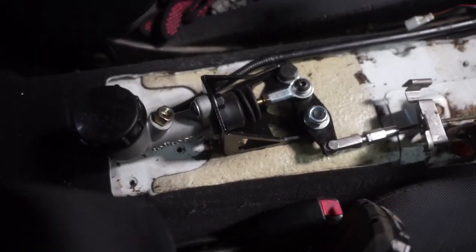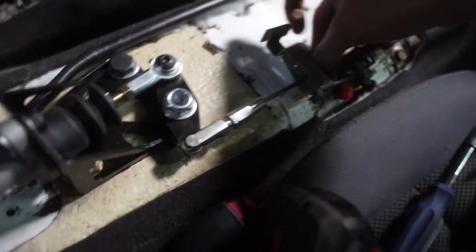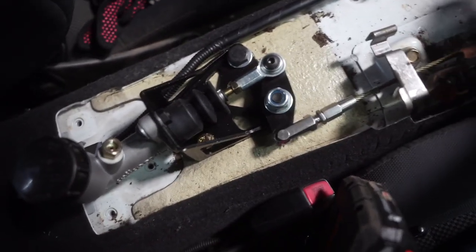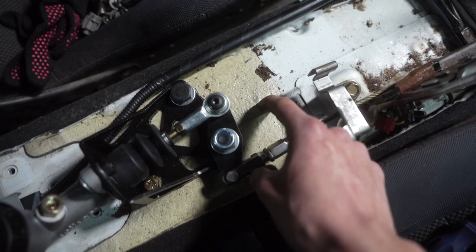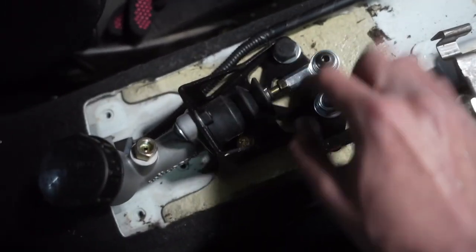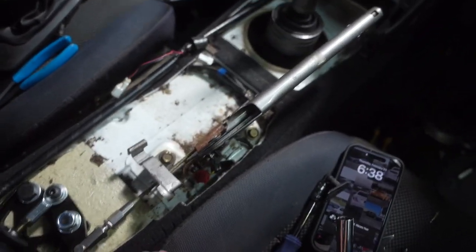Everything is in. That took a lot longer than expected. Right now the hydro is actually staying — essentially, when you pull it up it just stays there because there's no fluid in the system, so there's no pressure. But everything seems to be perfect. I might have to make a few adjustments — like tighten up the cable and all that — but I'm gonna do everything once there's fluid in the system and everything's done. I actually couldn't even use the hardware they provided due to the fact that I have the sound deadening. I used my own hardware for the back tube bolts and theirs for these — this hardware is fine because it is 10.9 grade. Glove box clears, everything's good. Now I'm gonna do the lines, and once I do the lines I'll move on to the short shifter and shift knob install.